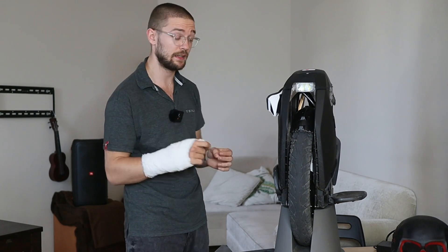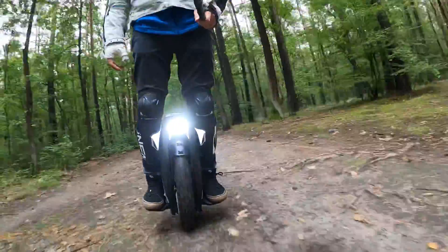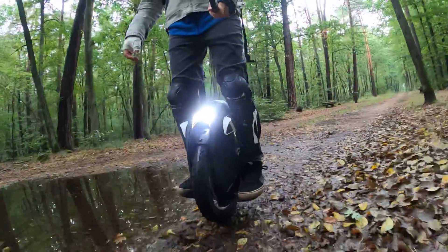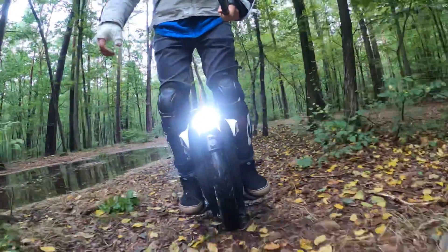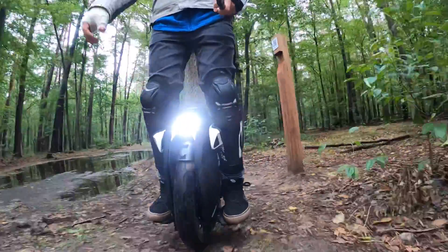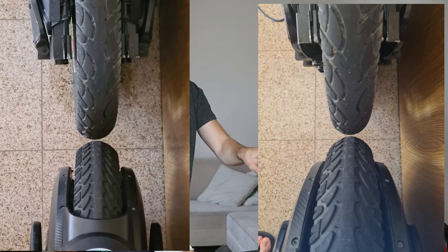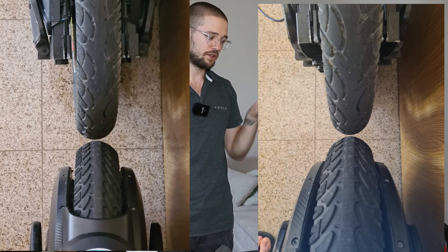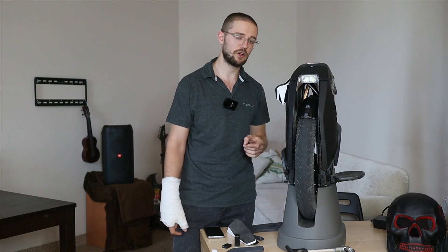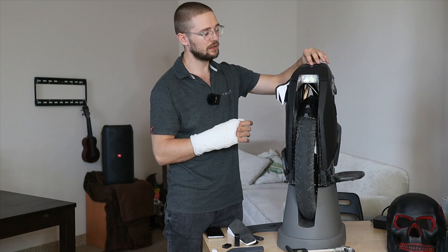The H5102 tire is one I really like — probably my favourite on 18-inch wheels — and it's good for off-road when it's dry with a lot of grip. But once you hit trails with mud or small debris, this tire doesn't have a lot of grip. On grass going uphill it's nearly impossible. I believe they went to a smaller tire because in previous S18 versions the wider CST tire was rubbing against the enclosure, so they just went with the smaller tire to eliminate that instead of changing the whole structure.